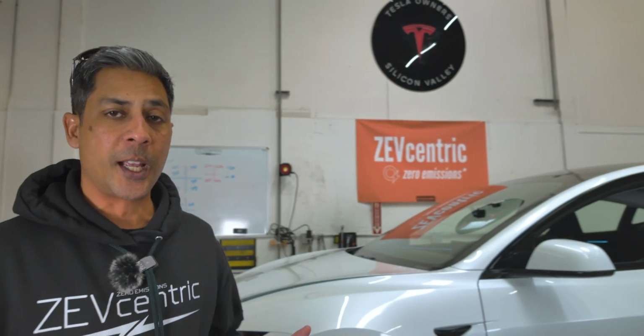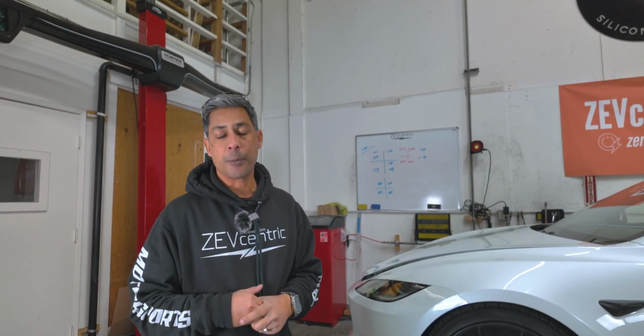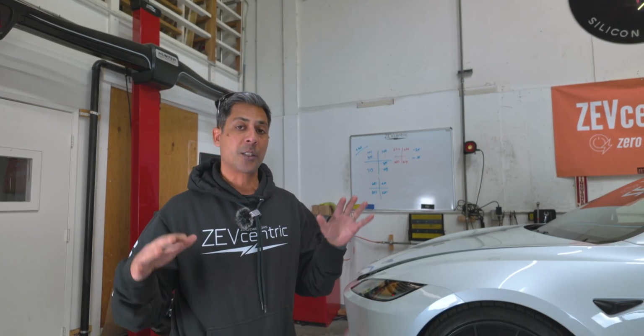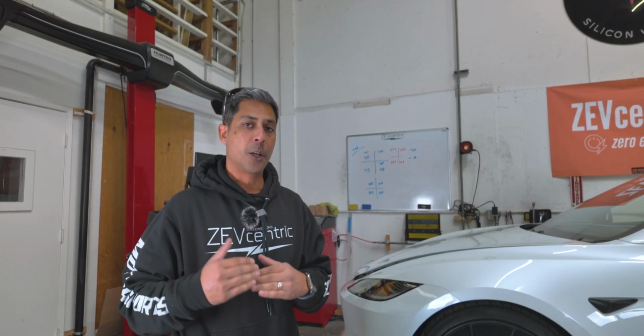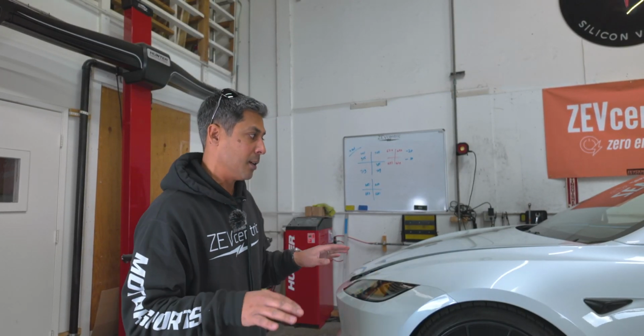Then we'll consult with the client, let them know that suspension springs typically do settle. When that happens, you guys will want to, at the very least, go get another alignment done so you don't wreck your tires because your toe values will be off as well as your rear camber. Or if you want to readjust the height, that's the best time to do it. Once the system is fully settled, go in, readjust your ride height to where you ultimately want it, and then do an alignment, and you'll be all good.